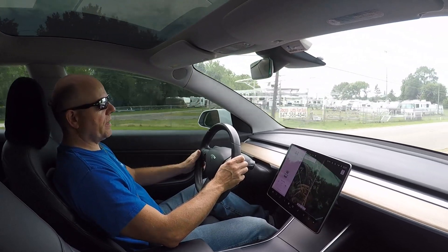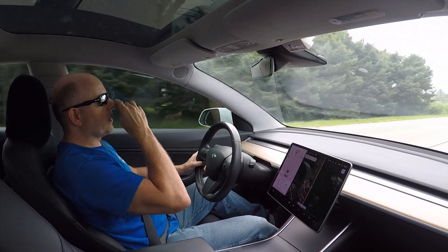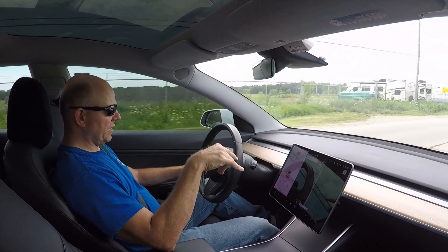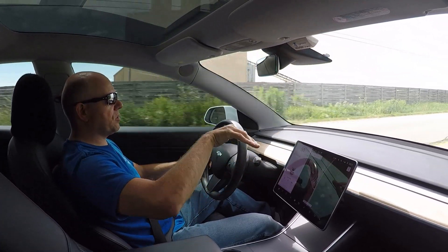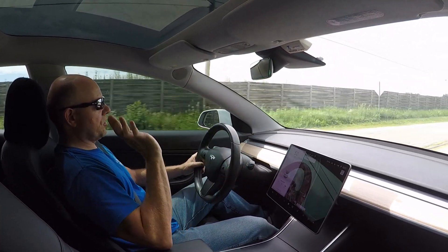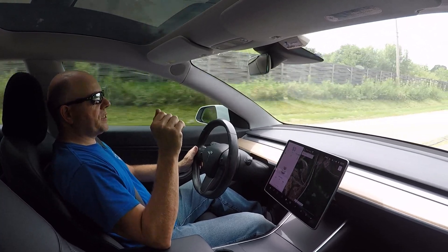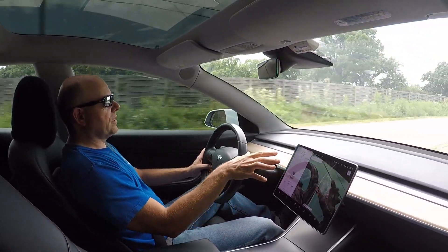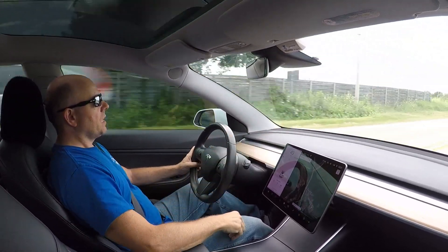The reason I didn't show the screen mount with the angle to the side is that I had one of the angles wrong. The original screen mounts that go down into the dash do so at a specific, relatively steep angle, and you have to flatten that out to get the screen to sweep side to side without tipping. I didn't get that secondary angle correct, so when I swept the screen to the side it was leaning left and looked weird. I spent most of today remachining and making one new part to correct this.